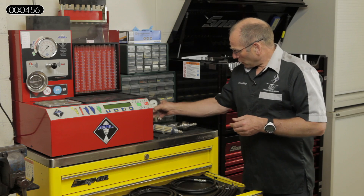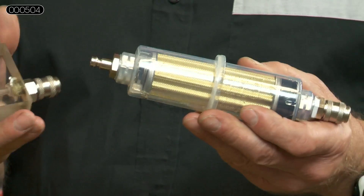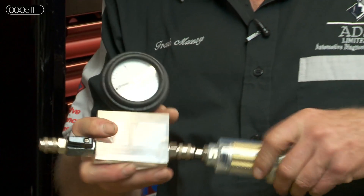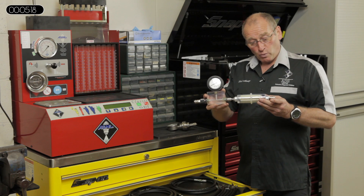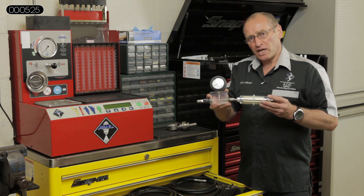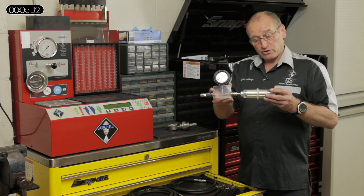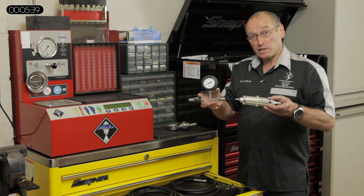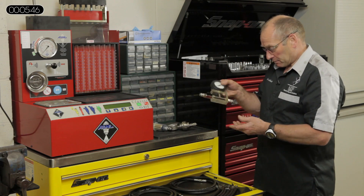Additionally, we wanted to protect the gauge against potential contamination. You'll see the benefits of these fittings — because they are quick release, they fit professionally. This filter will protect the gauge against contamination and will also act as a larger reservoir. So when we're checking flow, this clear housing also assists in that requirement. This filter would normally fit between the tank and the gauge. It's optional — if you're confident the fuel supply is clean, then of course you need not use that particular filter.